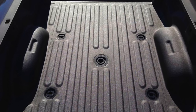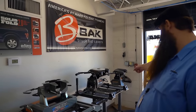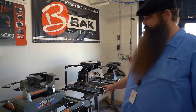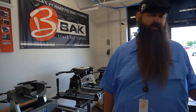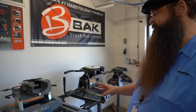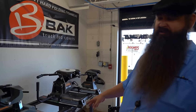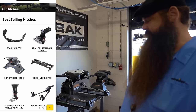A lot of trucks are now coming with what they call pucks from the factory. It's got little legs that you can lock into place, and it fits your truck without having to put any kind of base rail in your truck. So it's a very convenient option. Smaller vehicles are only going to be able to tow so much, so you don't have a whole lot of options. With fifth wheels going into trucks, trucks have a lot of different weight range capacities, so you want to make sure your truck can handle the trailer you're looking at, and also that the fifth wheel you're looking at can handle the trailer as well. You're limited by your fixed capacity, and generally it's usually the hitch. So definitely make sure you're getting the right capacity on that.